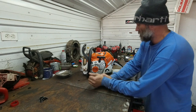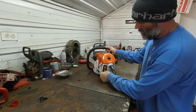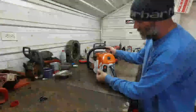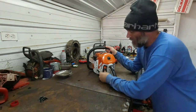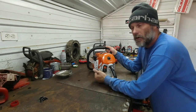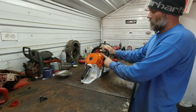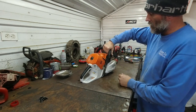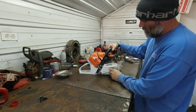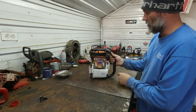This is a fuel injected saw. Has a primer bulb right here that primes the fuel system. When it's cold, you have to hit it seven times to build up pressure to start it. Has no choke, being fuel injected. Decomp comes off the top right. Magnesium clutch cover, has a captured bar nut, stainless steel muffler,